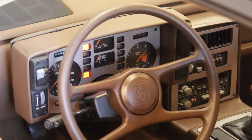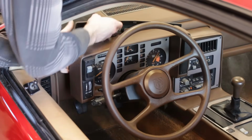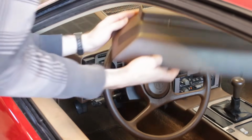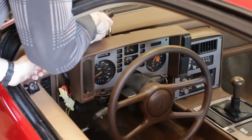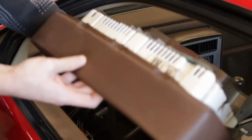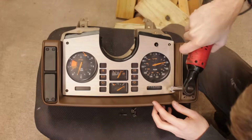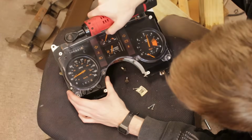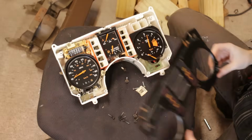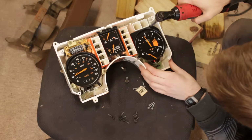Because the signal for it is based on the ignition pickup that the ECU uses, and the car runs perfectly fine, the issue is probably with the instrument cluster. I also know that it can't really be a mechanical problem. It's not actually stuck. The needle's position is controlled entirely by magnetism, no gears or anything like that. So the coils that control the magnetic field just aren't working as they should, and that could be a problem with the coils themselves or the circuitry controlling the coils. Whoa! I was not expecting that.